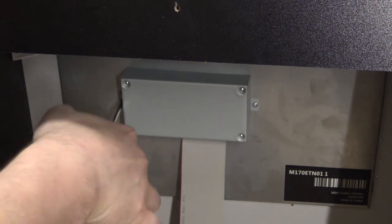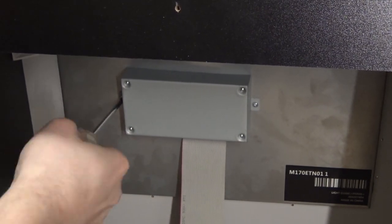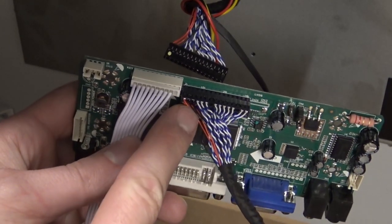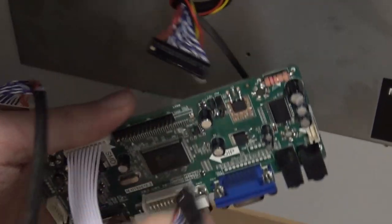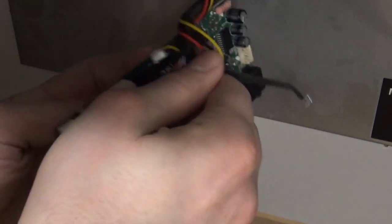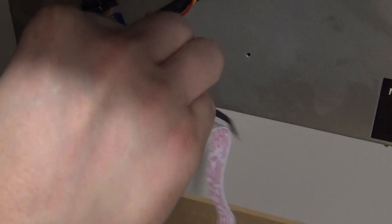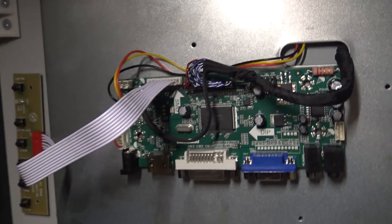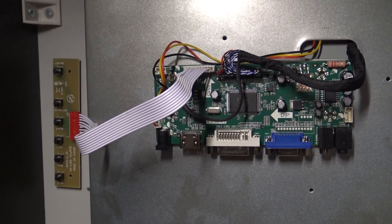You're going to need this board for modifying, and what I think is pretty cool is you can now adjust the brightness and contrast of the monitor itself. We're going to need to remove the protection cap over here, as well as the mainboard, because we're not going to use the original parts - same for the control panel and the monitor. We need to remove it all and assemble the tiny board so we can connect the HDMI. Be careful when you're pulling it out, so you know exactly where to put all the cables, otherwise you could have a defect or even ruin the PCB board.